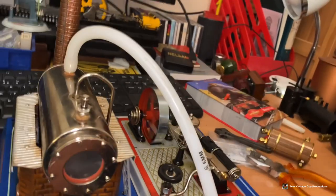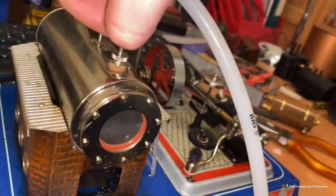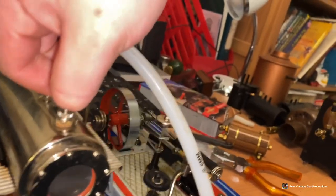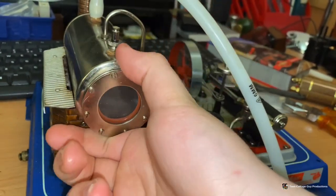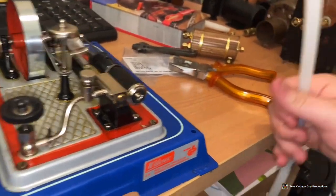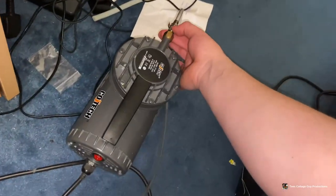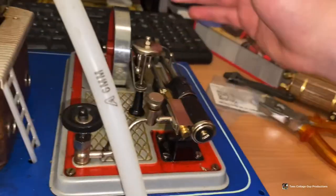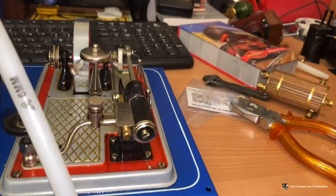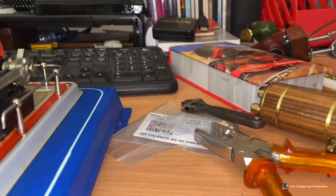And that's the maximum speed really when you look at compressed air. If I hold that open, there's enough air in there to run the engine. It is leaking a bit at the join here - that's fixed it. The valve slipped on the engine. Got to make sure that join's tight on the actual compressor itself, and I'll have to tighten up that jubilee clip.